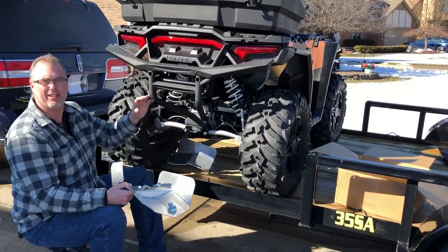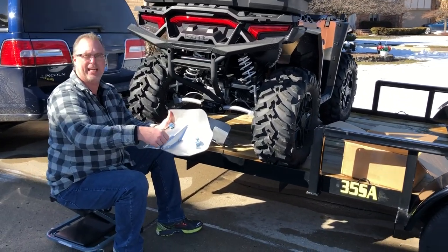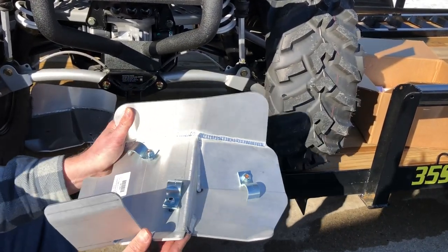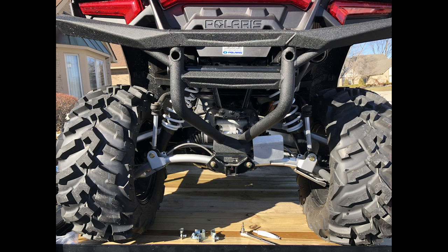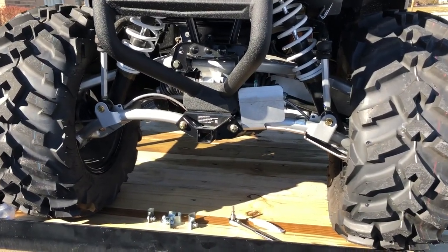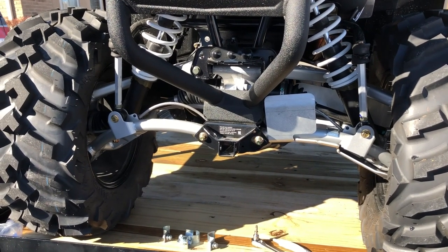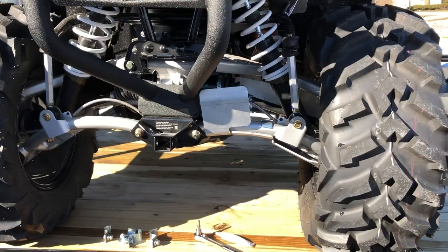Now we're on the back — parked on a little bit of an angle so it might look funny. We're going to do the two rear CV boot A-arm guards. We put the attachment kit on very lightly with a tiny bit of anti-seize lubricant, wiggle these over the A-arms, then use the Torx wrench to tighten them underneath. On the rears, make sure you put the right size hook clamps — the bigger ones go on the back and the smaller ones go on the front. The right one took us about seven or eight minutes just because we had a hard time reaching one, but still pretty easy.